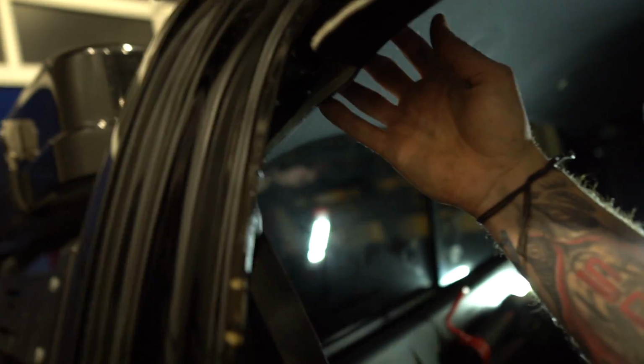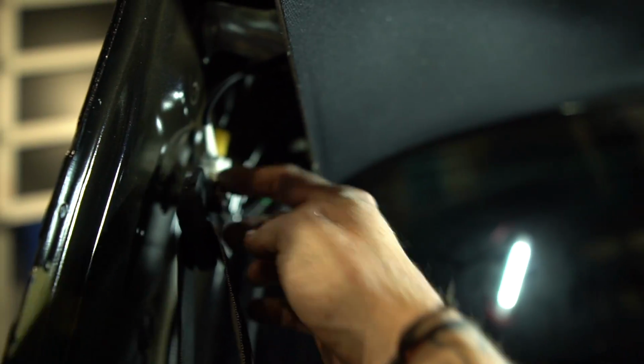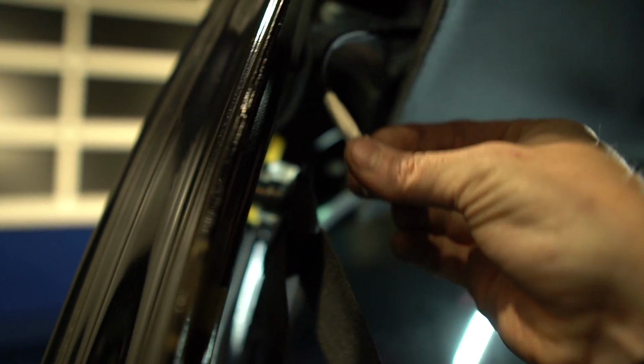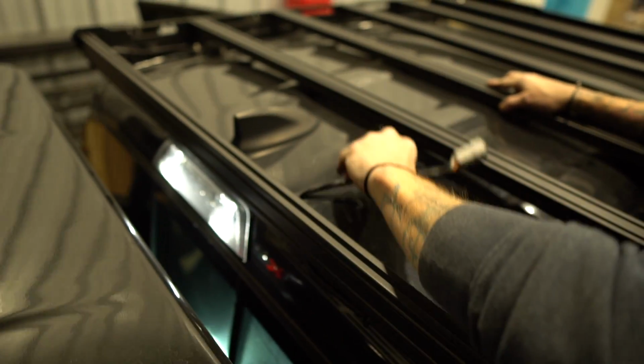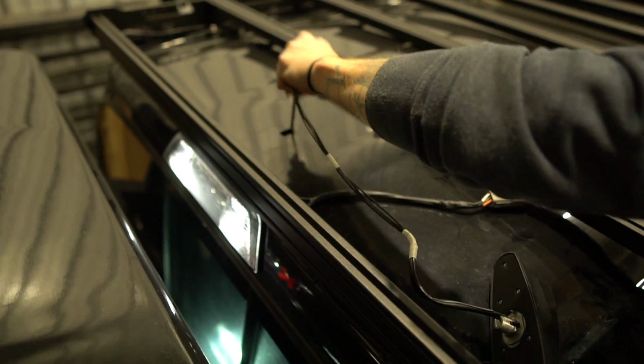And then if you follow this back, right inside of here, push this out of the way, is the plug to the antenna, right? So it's just white and it's above the passenger side seat belt. There's a little clip that you push on and it'll just unplug, okay? So once we have all that loose, we're free all the way up to the antenna. Go up. You just take the shark fin and literally take it right out of the truck.